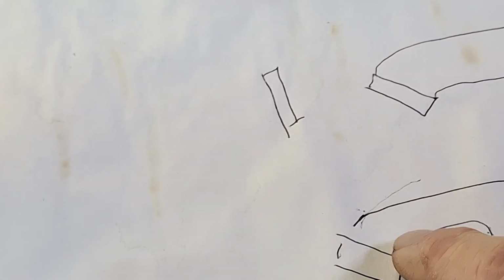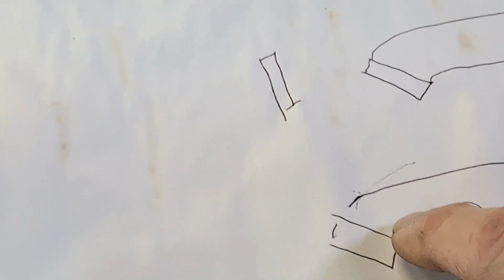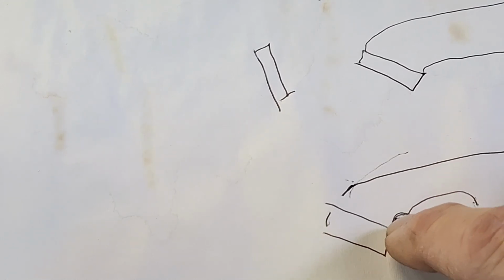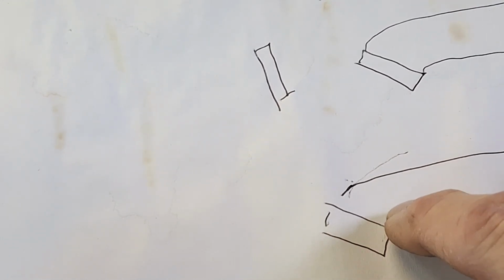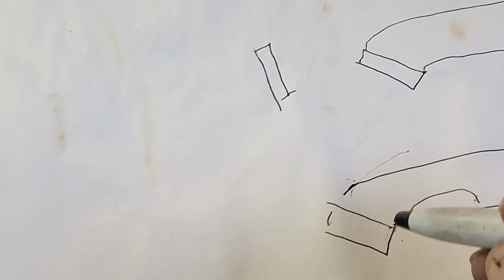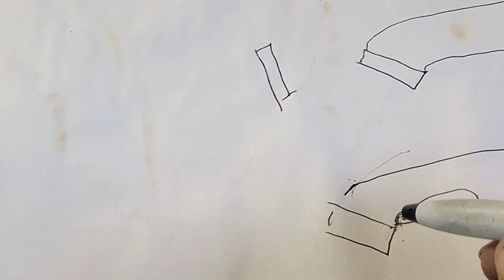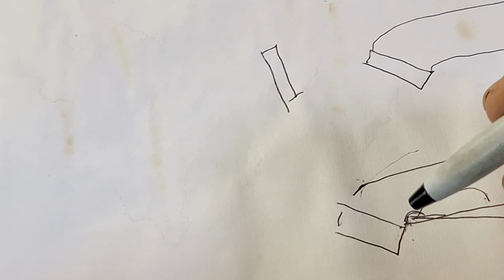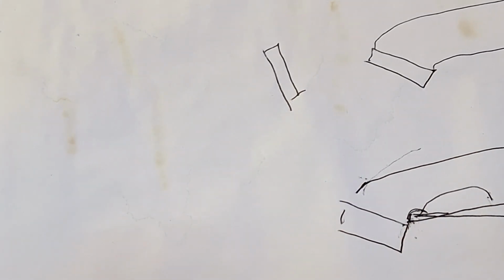It does work. If you've got a set of shovel heads off, run your finger up in there and feel it. I'm talking about earlier ones are even worse. Really sharp edge right there. So you could just give it a little radius in there. Take your sander on your die grinder and just give it a little radius around the floor of the port, down to the sides. Helps out immensely.